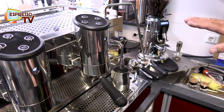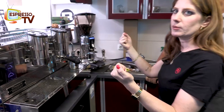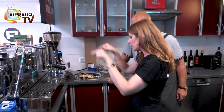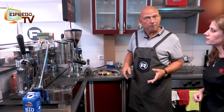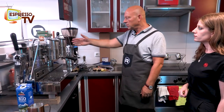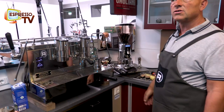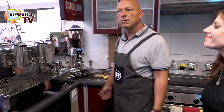Okay. And also the temperature of the hot water can be set. Yes, it can be set, but we need to reopen it a little bit, with a screwdriver. Because it's a kind of mixed water between the hot water in the boiler and the cold water condition. For example, green tea needs a different temperature than black tea. This is why you have two hot water buttons. You can set the quantity here for single and double, and the temperature you adjust according to what you want to serve by the bypass of cold water to hot water. Yeah, that's it more or less.